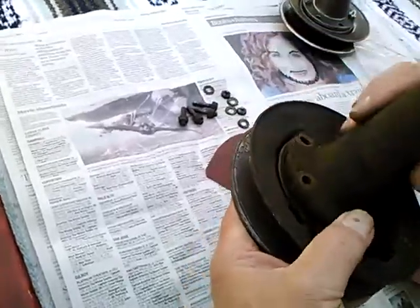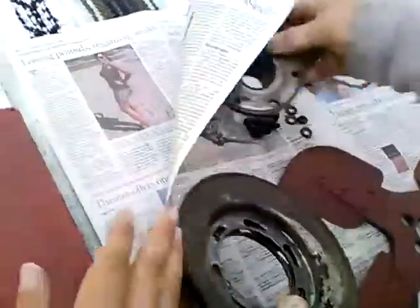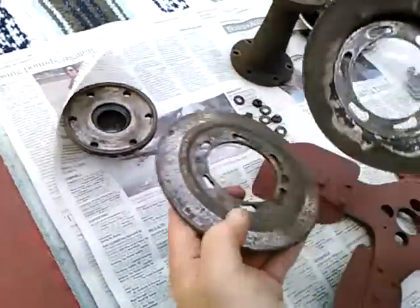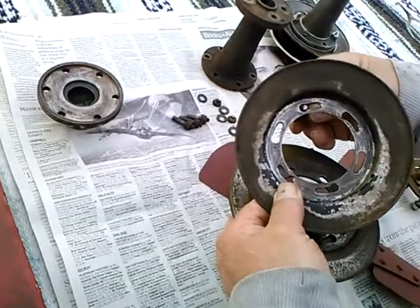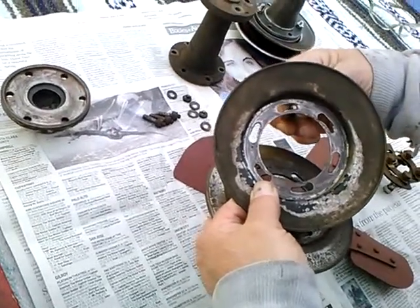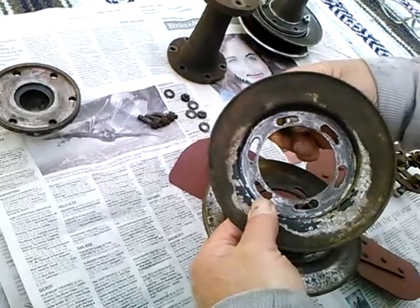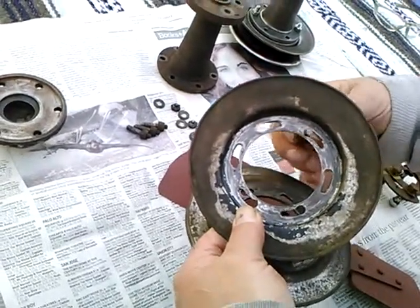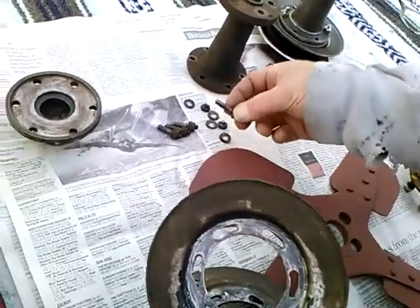So they started to dig into the pulley halves. As the bolts drove the pulley, they wore their way, turning these holes into slots. As they were moving along, they got smaller and smaller, so these slots you see get smaller and smaller. And then they started to break.